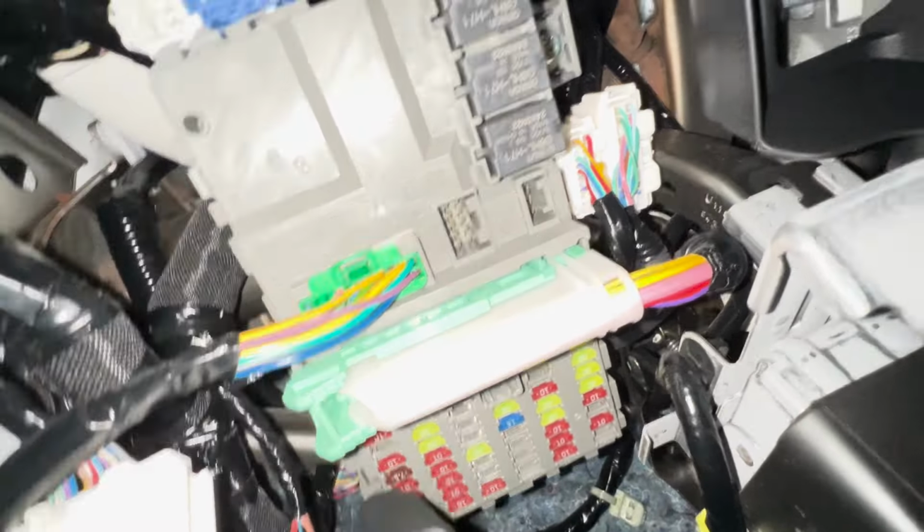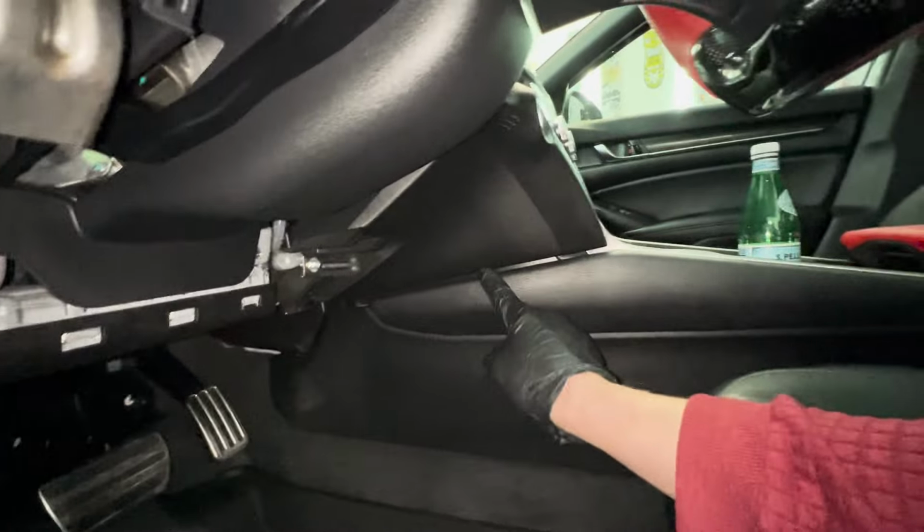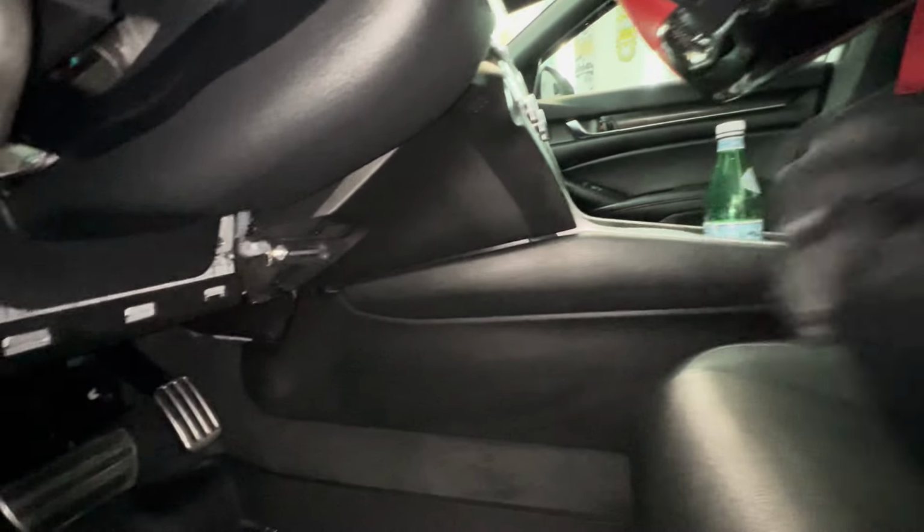then this is the fuse, right? The 10 under the 7.5 right there, the 10 under the 7.5. You could use that as well. So I'm just gonna tap into that fuse over there. All right, and I'm gonna connect the black wire to the ground right there. Let the main controller sit here, which you guys could do, because I can't hold the camera and make videos for you guys. I'll show you guys over here where the center light's gonna go at.